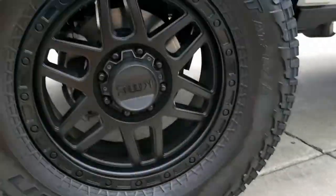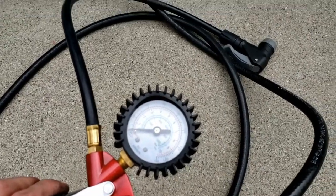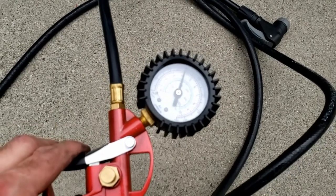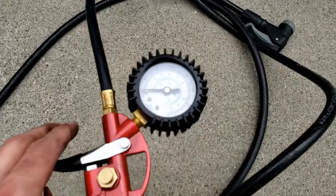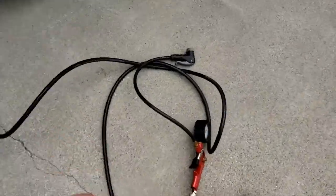I've already hooked it up to my tire and it does work. The compressor kicks on when pressure drops below 70 psi and shuts off at 100 psi. I can also shut off the compressor from Aux 1 in the app — come up here, shut it off, and when I bleed the pressure from the system it won't kick back on.